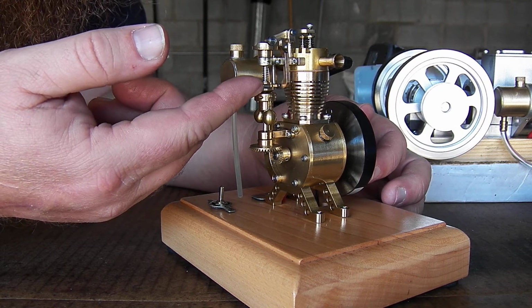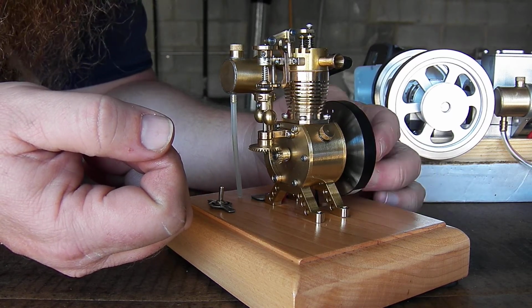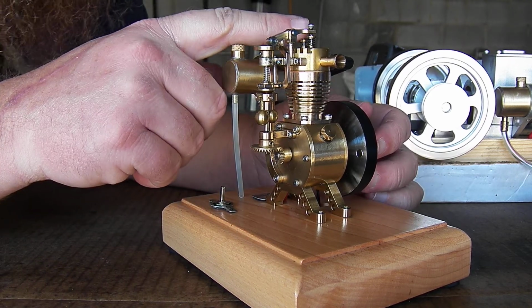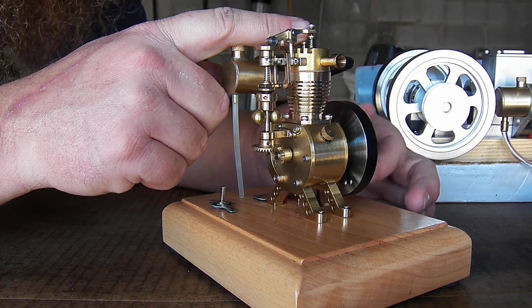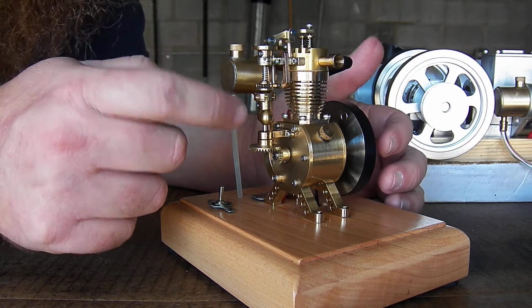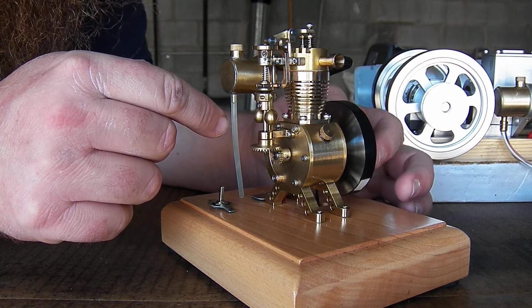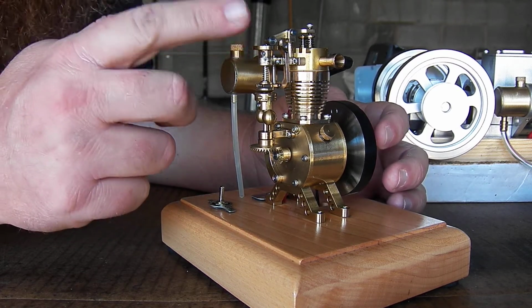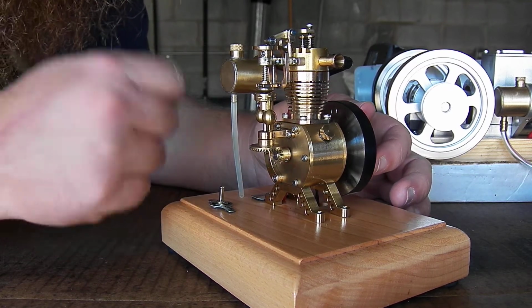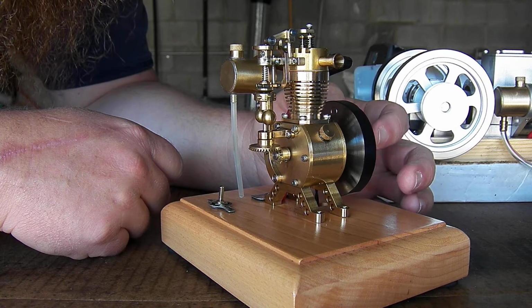The ET series is just a lot easier to get going and keep in order. The EM series, you just have to get either incredibly lucky with the engine you get and have it be just in order right away, and all the set screws work, or because they're so tiny, those set screws just have to get Loctited in, and you need to be prepared to go in and double check all the timing and double check everything and get it set in place with Loctite on the set screws, so it'll run okay, or so it'll run real nice.